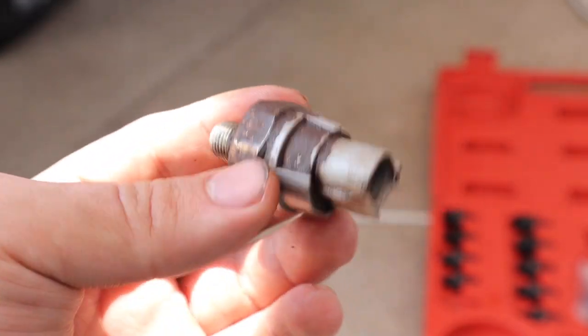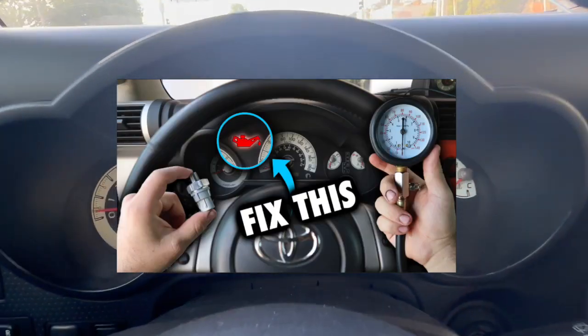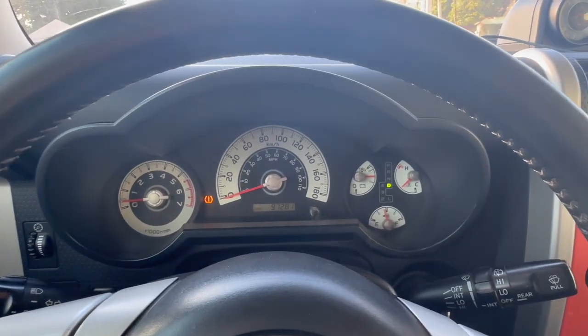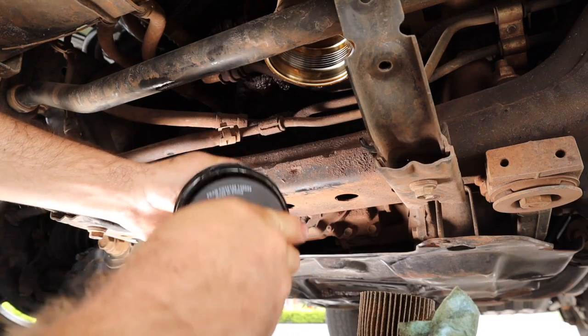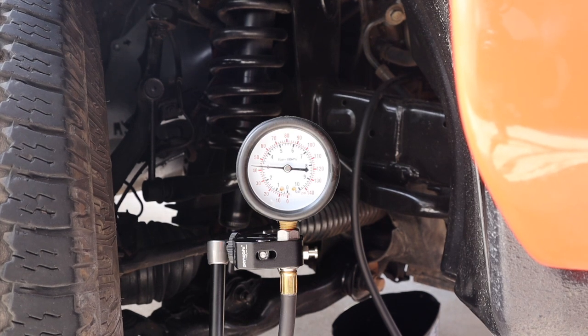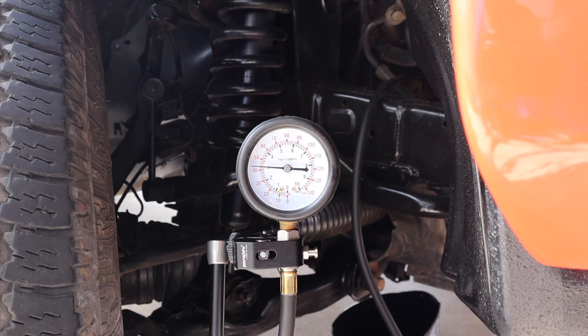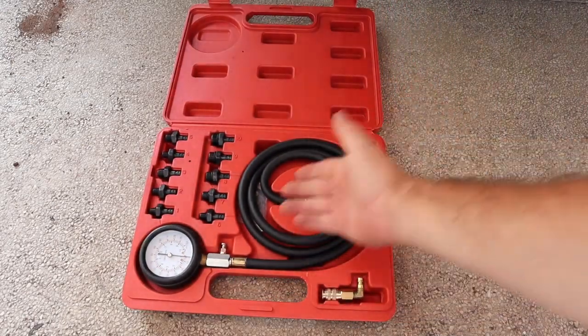For a detailed video on how to find, diagnose and repair low oil pressure, check out that video. But what if we have high oil pressure — let's say 85 psi? The most common reasons for high oil pressure are dirty oil filters and debris in your engine. There could be routes and ports clogged by gasket material, rust, or other debris, causing more back pressure. If you have high oil pressure, start by replacing that filter. All tools used in this video are down in the description below.